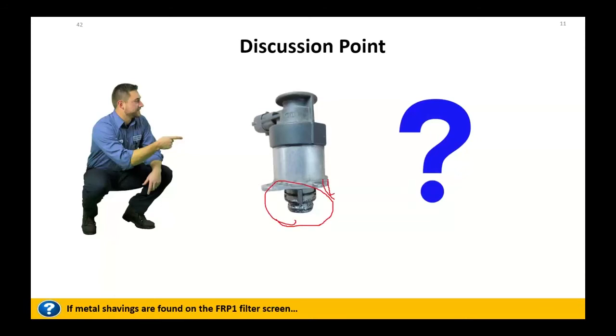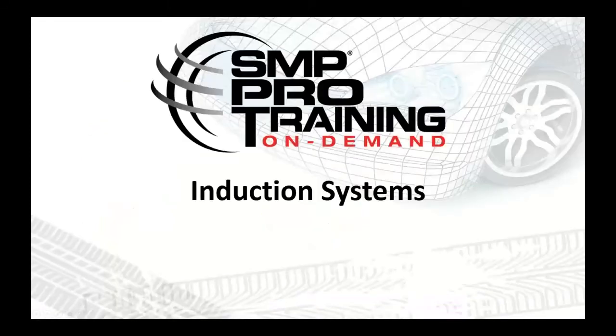So you can't just throw a high-pressure pump in this thing and expect it to last. Those shavings are going to find their way back to that high-pressure pump, and they're going to cause you to do this all over again. We want to prevent the comebacks by watching what we're doing.